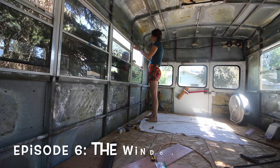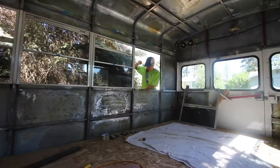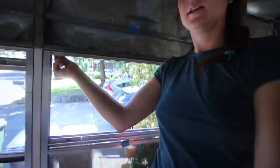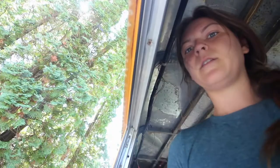There's a hole in my bus. I put a baggie with all of the bolts for each window above each window well. Each window has a number. There is some weather stripping stuffed up in here that we pull out, and this will expose a screw right here. That comes out as well as four screws among these rims here.